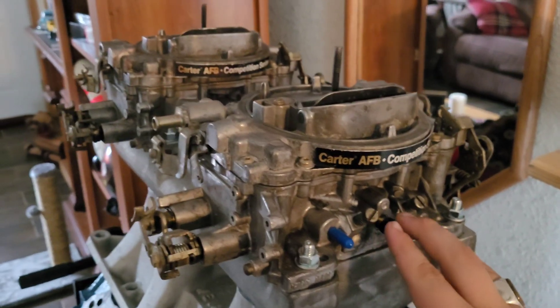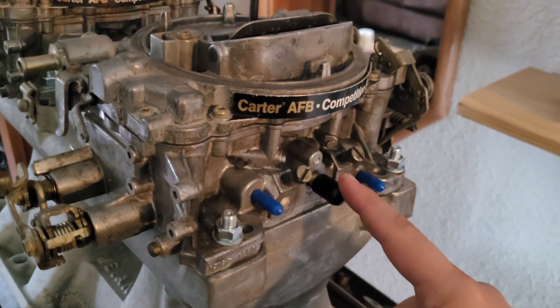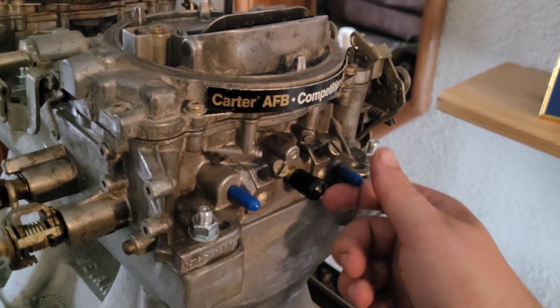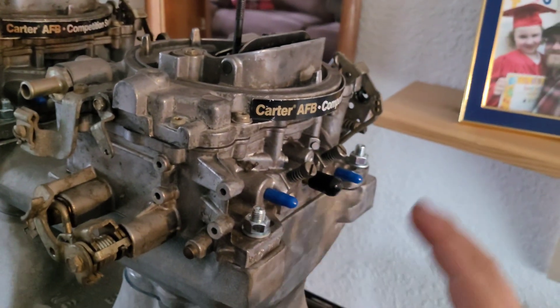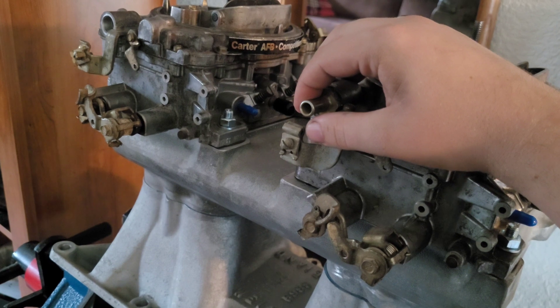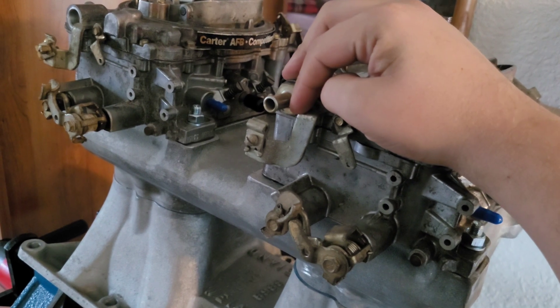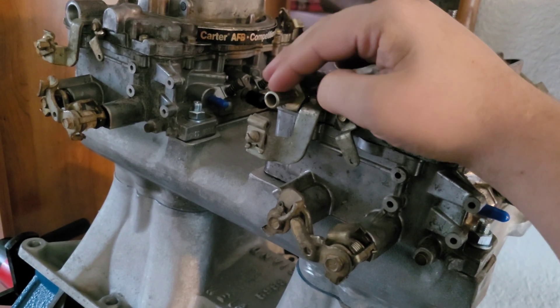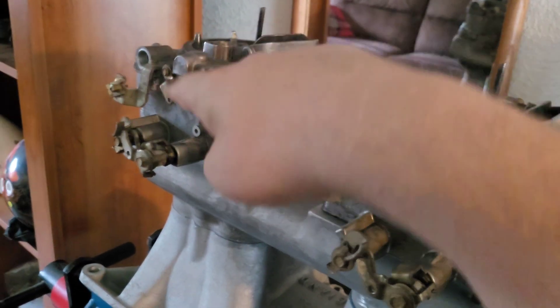But wait — we have a tunnel ram that I'm going to show you real quick before we head off. The next video is going to be all about tunnel ram. I got my vacuum plugs — we'll use one of these off one of the carburetors, and we'll use manifold vacuum for the vacuum gauge. The rest are all plugged up. I need fuel outlets for a dash six AN line — I have those on order, coming in the mail this weekend, so we'll be able to plumb our fuel line.